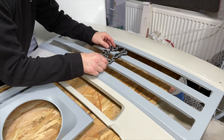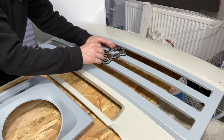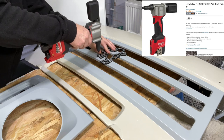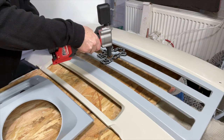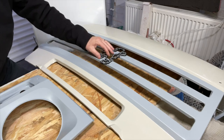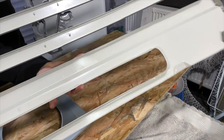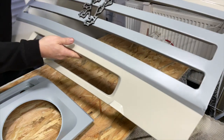From strength to strength - we'll get that riveted back onto the front of this new grill. Look at that - that looks super doesn't it. I've got some nice fresh rivets to pop through - these are really tiny small rivets so they haven't got a lot of pull, meaning they're not going to crack the plastic. I've got my Milwaukee rivet gun and it just pops them off lovely. We'll put the other three in and pull them down. That is going to be fixed on there and it ain't falling off in a hurry. Really pleased - that looks a million dollars. You can see the rivets coming through the back, they've really taken nicely. Ready to go back on the van.